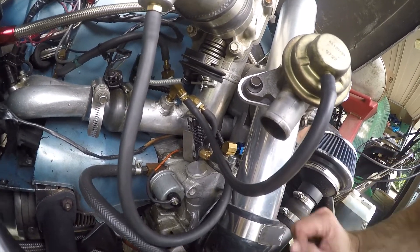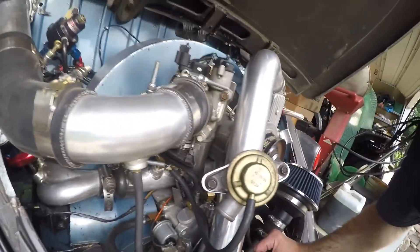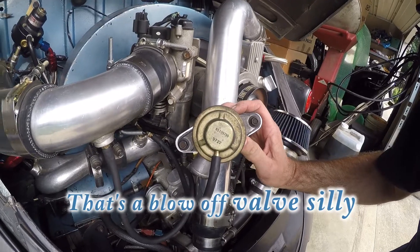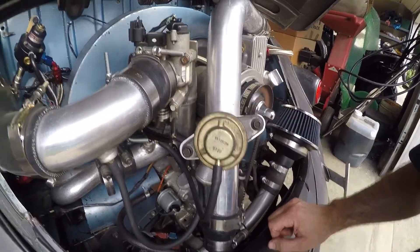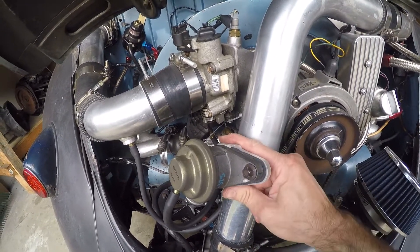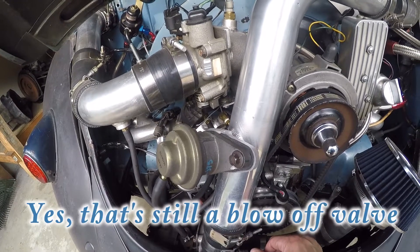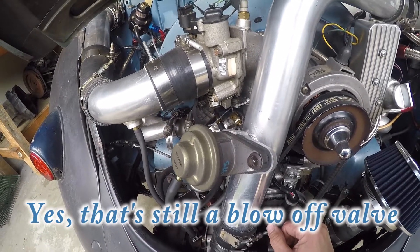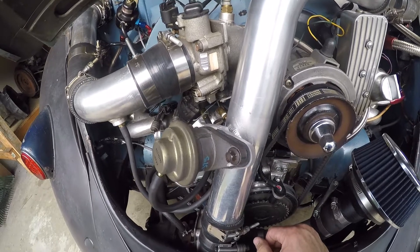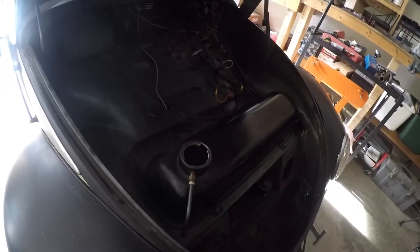Right now, with it all the way backed out, I was getting about 13 to 14 pounds. Where I was losing some boost was the wastegate. I wasn't quite sure if I was going to run this Subaru wastegate, so I just put a makeshift adapter bracket on it. It was kind of thin — just to test the wastegate out. It worked pretty well other than losing boost, so I went and made a new bracket and had a friend weld it right to the tube. It seems to be holding boost now.